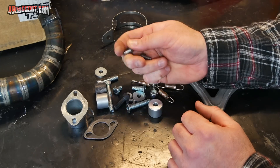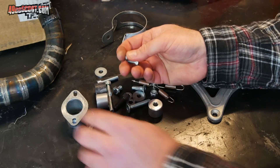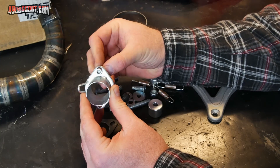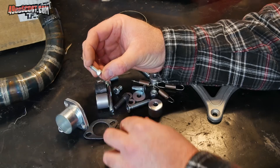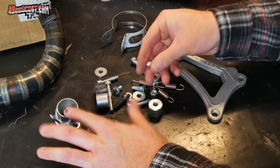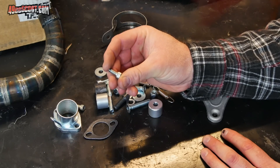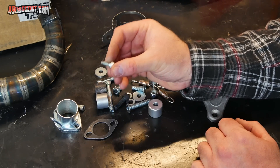According to their diagram, you can use original studs with hex nuts. Sometimes with these exhausts that have large headers you actually can't use a hex nut, but it looks like these would clear — so it's up to you. Make sure you source those before you get going. It's important to check the length of these bolts because you can bottom out, and you don't want to over-tighten and strip something out by bottoming very long bolts into your cylinder.